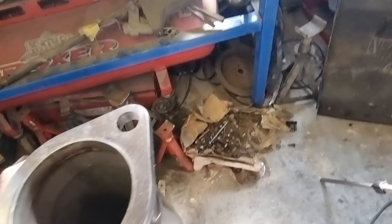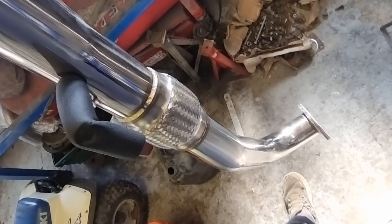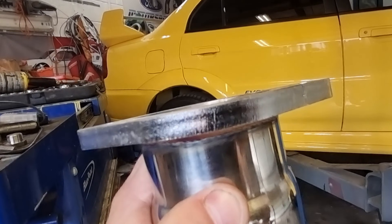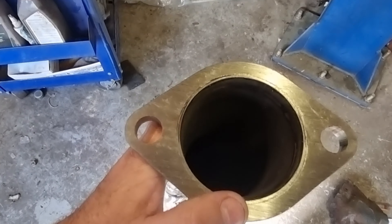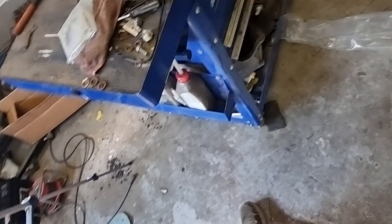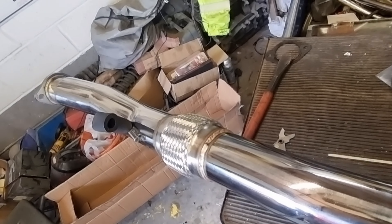Let me get it out in the sun so the camera picks it up — yeah, that's better. At that angle you can see a lot of penetration all the way through, really really nice. Let's check the flange condition. Looking down it, that's nice and straight. You can see the crosshatch marks where it's been surfaced — after welding they've put it on a flat sander to straighten the mating flanges, just to prevent warpage. Really happy with that.